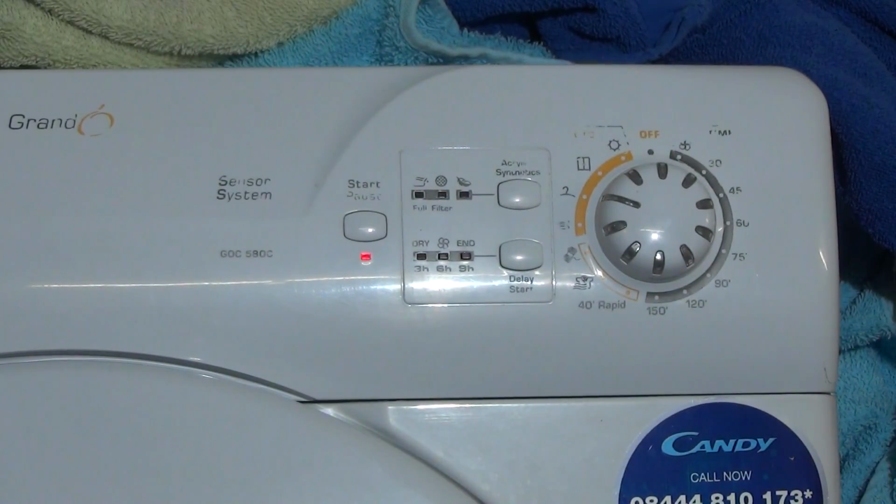Hanger dry / standard. This is the standard cycle for the machine. It gets it completely dry, but it only really works well on fabrics with the same thickness. So if you're drying a load of towels, this works actually very well. Now weirdly, the extra dry option at the top sometimes is labelled as all towels later on, and to be honest, it's actually incorrect really. All towels should be the hanger dry setting. I did a whole load of just towels, and it came out perfectly dry.